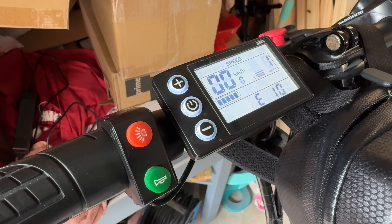In this case it is the E10, but if you have E2 that is the brake problem, E3 is power sensor failure, E4 is six kilometer per hour cruise failure, E5 is real-time cruise, E6 is battery under voltage, E7 is motor failure, E8 is turn fault, E9 is control failure, E10 is our failure — it's a communication reception failure, E11 is communication failure, E12 is BMS communication failure.